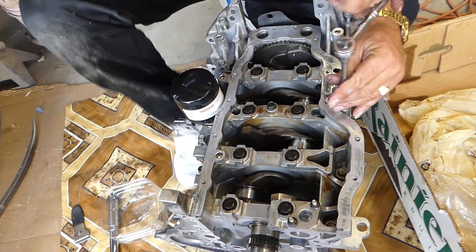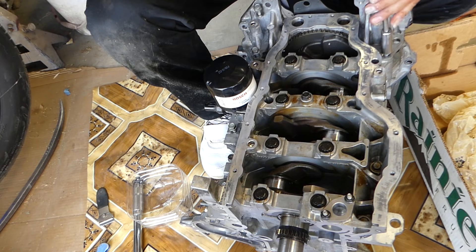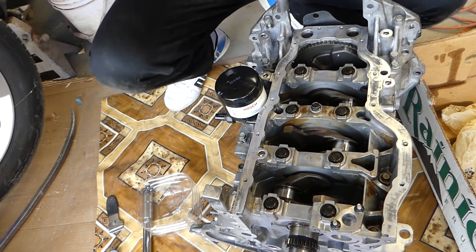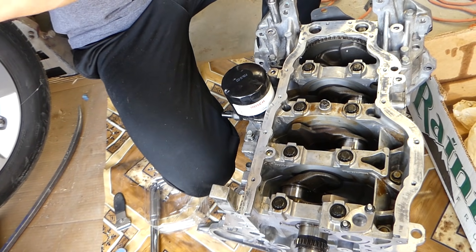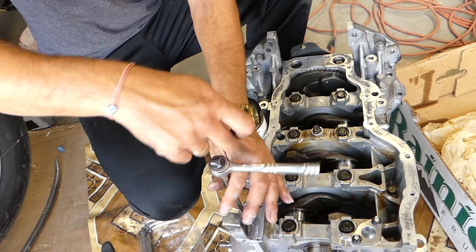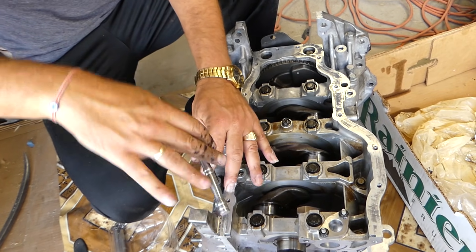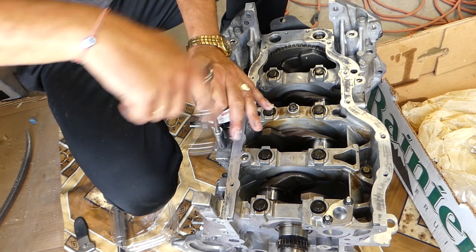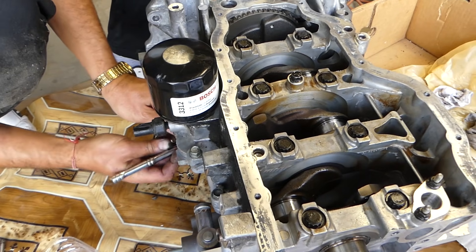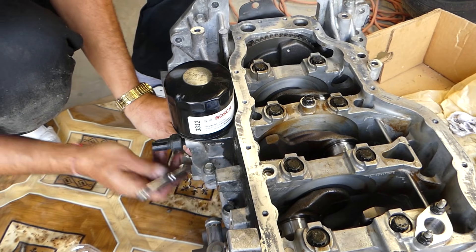Sequence is very important again — do not get them too tight by hand. For the torque specs, according to the manual: 13.7 to 17.4 pound-feet, which is the same as 18.6 to 23.5 Newton-meters. We'll use a smaller torque wrench for more precision, somewhere in the middle — about 21.6 Newton-meters. We will be using an extension, so that will set the torque off a little bit, but since it's a wide range, setting it toward the higher end will be fine.